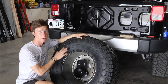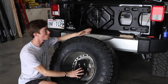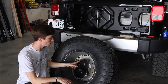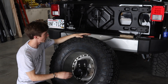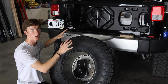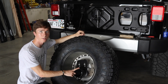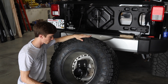Before we get the spare tire mounted on the tire carrier, there is an extra bracket that goes inside of the tire carrier — this is what makes it adjustable. Not only can you move the tire up and down depending on the clearance of the rear bumper, but you also want to make sure you clear the little dip. Positioning the lug nuts on the adjustable bracket is essential when assembling the tire carrier. We attached one lug nut to the bottom of the spare tire, then lifted the spare tire up onto the tire carrier. We pushed the spare tire as far against the tailgate as we can, then I used a silver sharpie to mark the edge along where the adjustable bracket lines up with the tire carrier. Now I'll take this off, assemble just the bracket on the spare tire carrier, and then put the spare tire on the Jeep.